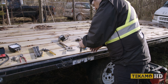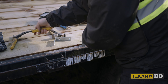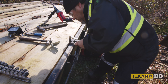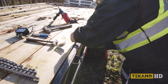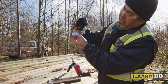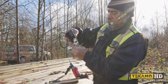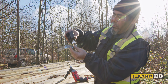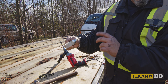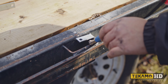Now we're going to see if we can give it a twist using this gentleman's trailer. It should twist and look something like this. When we mount it on the cab we have our light, but because it's too far out we're going to give it a little bend right in the middle. At least the twist worked out nice — it just needs a little filing. We're going to give it a 90 degree bend right here between both bolt holes, so it sits closer to the cab and doesn't vibrate so much. It should set it very close to the center of the square bars on the front windscreen. We got a good straight bend in — now let's do a test fit.